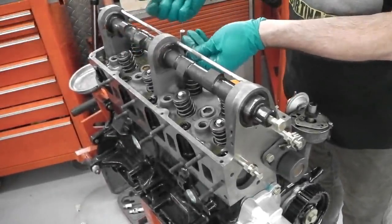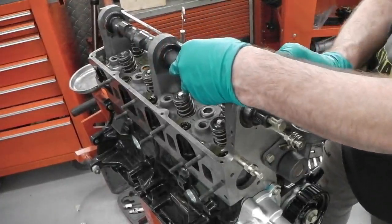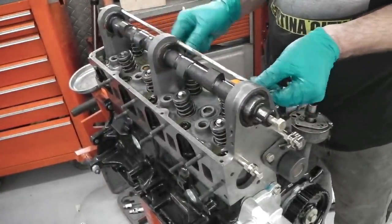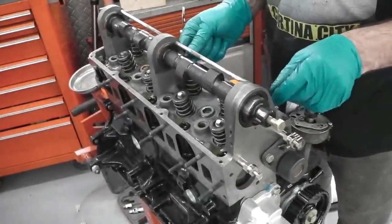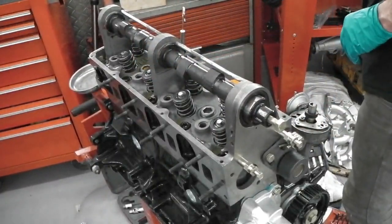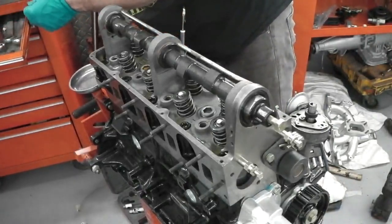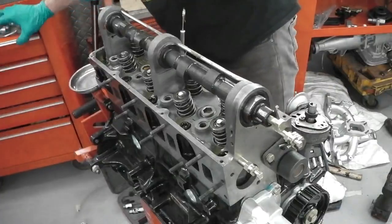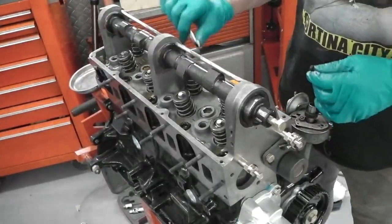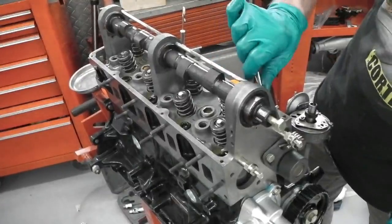Okay, spray bar. This is a new old stock spray bar. They do say enlarge the holes. Also, this spray bar's missing, I believe, a little rubber O-ring which would sit on the end there. Don't worry, this is just for now. I'm not going with this completely. I'm just nipping it up by hand just to see what we get. Okay, so I'm just going to get a spanner and tighten these up. 10 is what we need. 10's on the bench. But I don't think it will seal. It might do. I'm sure it has a little rubber inlay. We'll find out soon.